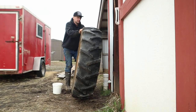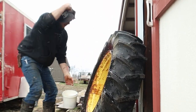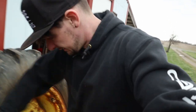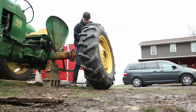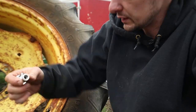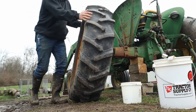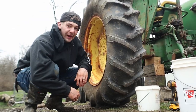I'm gonna soap this thing up real good again so that it can push out onto the outside to set the bead a lot easier. Got it aired up and it is tight all the way around - that is looking great! It's seated really nice from what I can tell. I'm going to roll it over to the tractor. This is what came out - it's like the entire valve stem with a bigger piece that threads right on, then you're able to hook a garden hose in there. Had to let the air back out first so it's low enough to get back on.